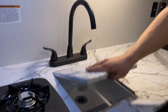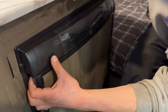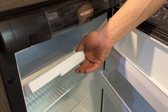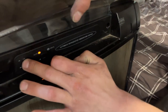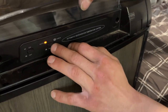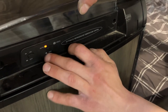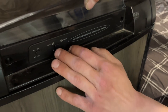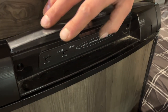More storage space here. There's a little light above the sink — just a center push button. Hot and cold water, of course. For the fridge, there's a little thumb latch on the side — push that up to open it and get access to the fridge down low and your freezer up top. Open it up and you get your power button on the left — push it in flush and it's turned on. The button on the right, pushed in flush, puts it in Auto. Auto first looks for AC power; if AC power is taken away, it automatically flips over to gas. If you're dry camping and want it running solely on gas, let that button come out and it'll fire up on gas only. If the check light comes on, it just means it hasn't fired up — turn it off and back on to reset it.